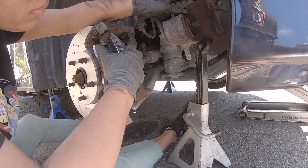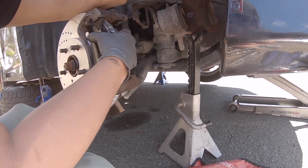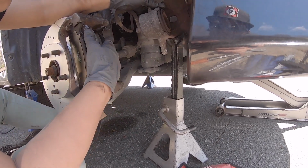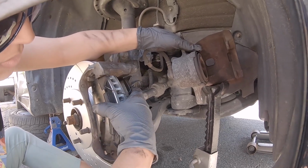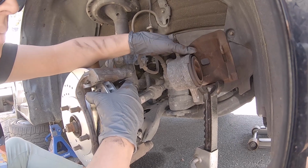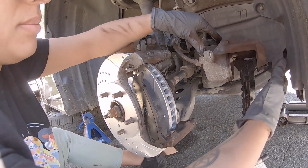And then, like, never put your legs under a car. Well, you can because you've got jack stands. If you just had a jack and stuff like that, make sure it's safely secure, but it's good. And we got a tire under there too, so if it did fall, the tire is going to catch and save your appendages. Why don't you get that mounted first so you can use both hands?